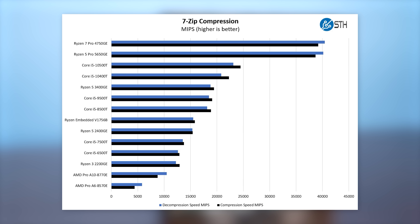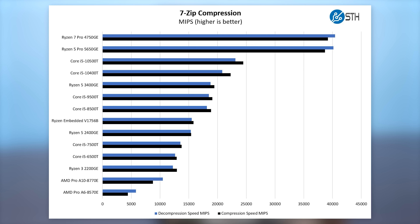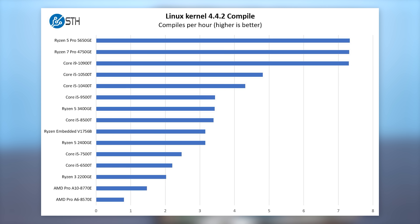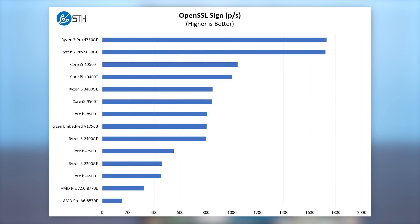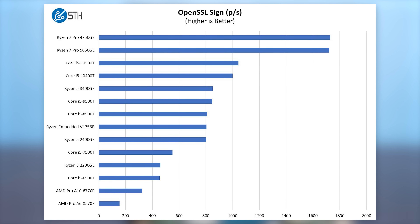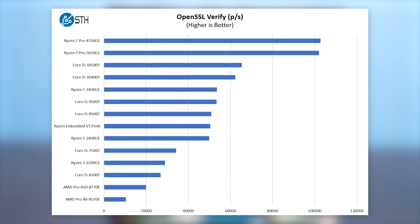Let's get to power and performance. We have the AMD Ryzen Pro 5 2400GE — a four-core, eight-thread processor, older generation Zen architecture, not Zen 2 or Zen 3. This was interesting because AMD did something a little different than Intel at the time. Intel responded to AMD entering the market by moving from the four-core, four-thread Core i5-7500T up to six cores and six threads with the 8500T. The AMD Ryzen 2400GE is actually very competitive with the 8500T. There are cases where Intel does a little better because of physical cores, but you can think of this as roughly an 8500T-ish competitor across Project Tiny Mini Micro nodes.